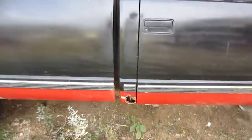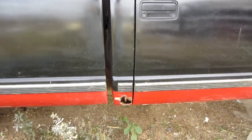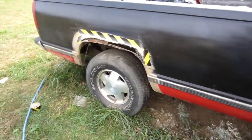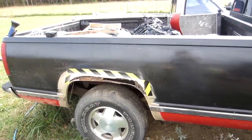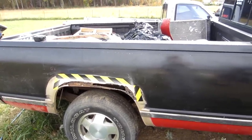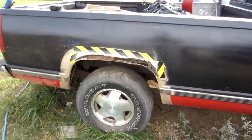What I'm gonna do is take some of that fender metal and patch up the hole in that one, because that one's not rotted all the way through — it's close but not all the way. Once I do that, should be good to go: get both these sides painted up, tack weld it in, put a final slim bead on it the whole way around, grind it back down, and then start filling it in with body putty.